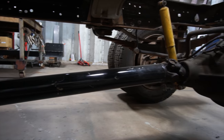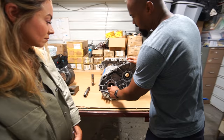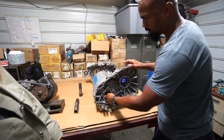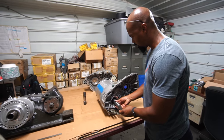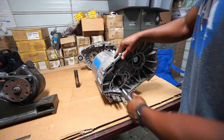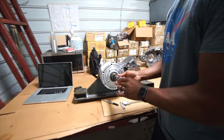We had to take all of this out, which is what we did on this one, and we had to go right down to the spline of the motor, which is this right here — this is the actual motor that's spinning. So we had to have a special spline designed and cut which fits over top of this, just like such, and then that goes and slides inside of the transfer case.